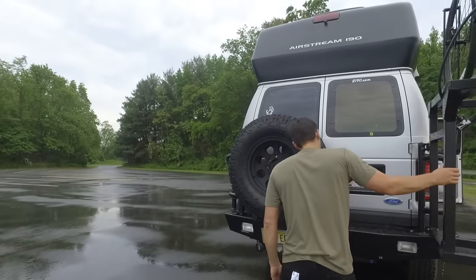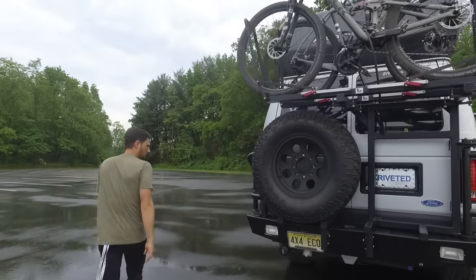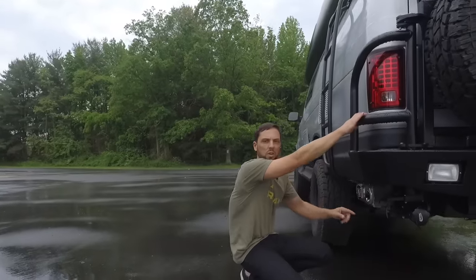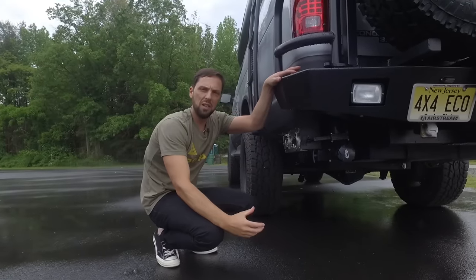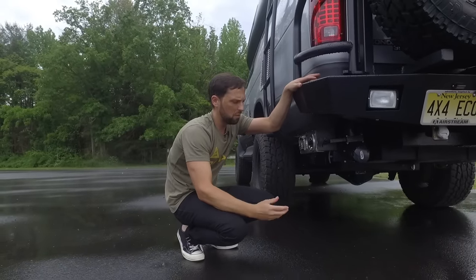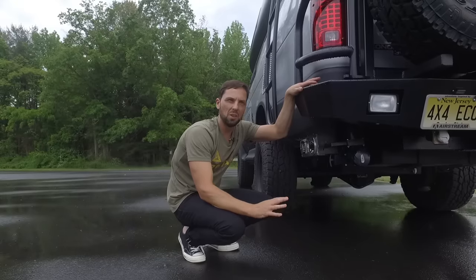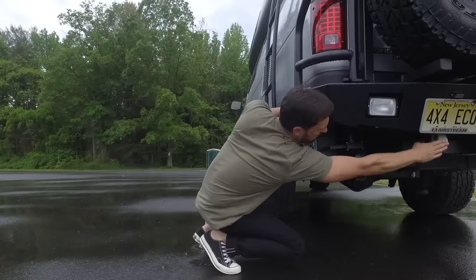And these are very secure once you have them dialed in. The waste system, the tanks are all heated, so when you have the furnace on, there's ductwork that goes down into the insulated tank chamber to prevent that from freezing. It gives you about a 10 degree boost in temperature in the tank, so if you get below freezing at night, you're still in a safe situation.